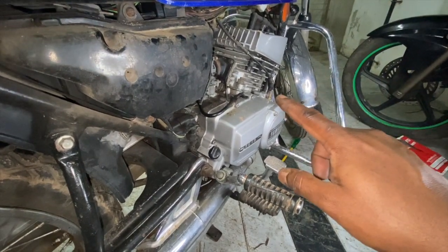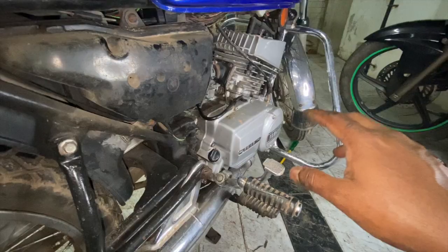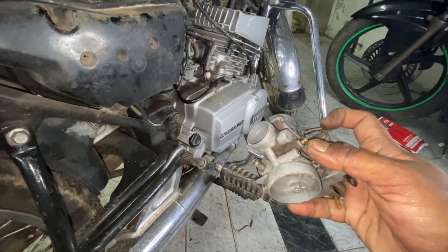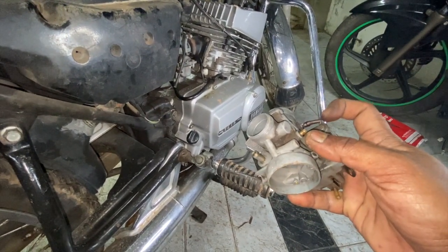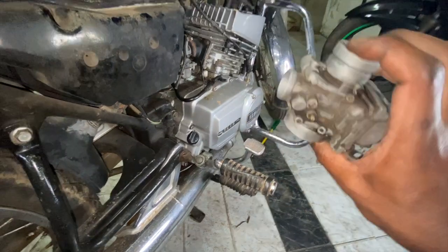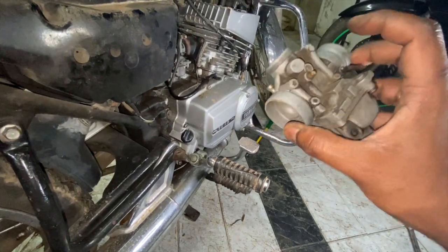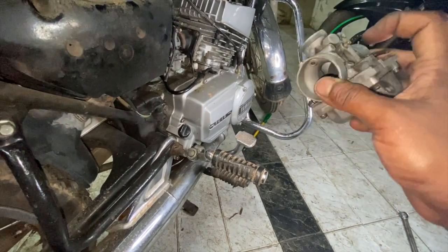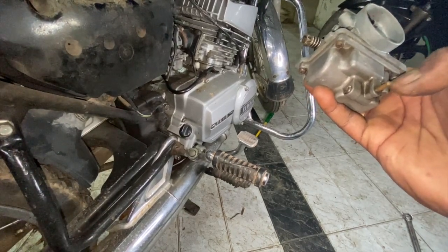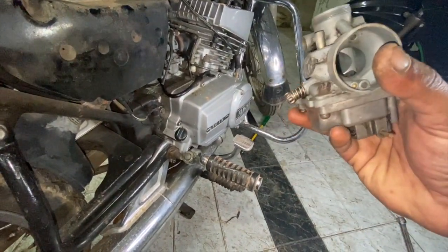So the first thing we spoke about is the 2T inlet. Make sure the 2T inlet is plugged if you do not have a working 2T pump. The easiest way to do that: take a small piece of pipe, heat one end, just pinch it with your finger and that seals it, then insert the other end into the inlet. That creates a sealed system so the carburetor won't pull air from there anymore. The carburetor can pull air from other inlets like overflow inlets, but those only go into the bowl — the 2T inlet throws air directly into the combustion chamber, which is why you get the lean issue.